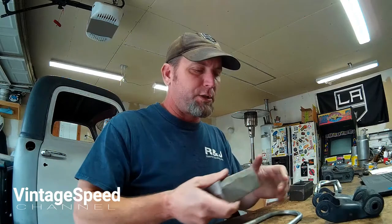Hey guys, good afternoon. Today I'm working on the P48, which is our 1948 Chevy 3100. I'm getting rid of our old 3-inch drop blocks and the U-bolts that I hokey-fabbed together and welded — those were for mock-up purposes — and replacing all that with our nice cast-iron 2-inch blocks that I got in.